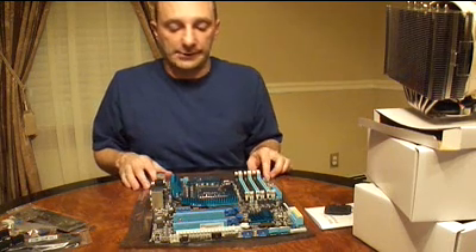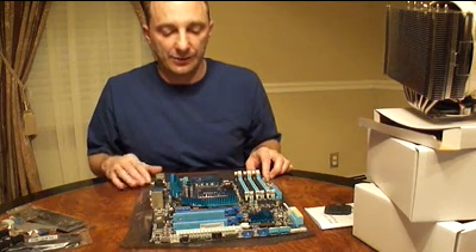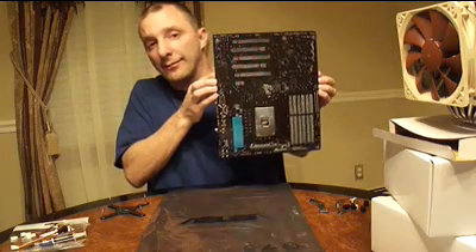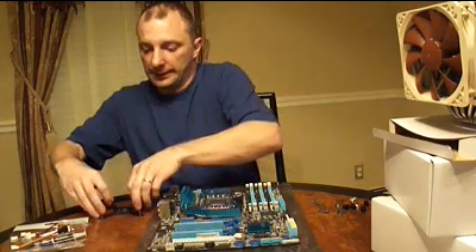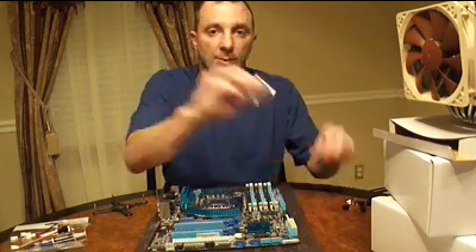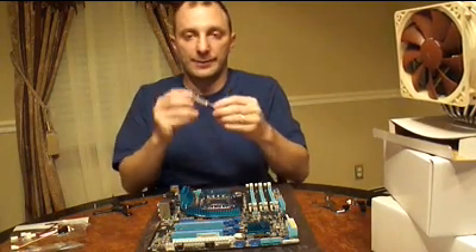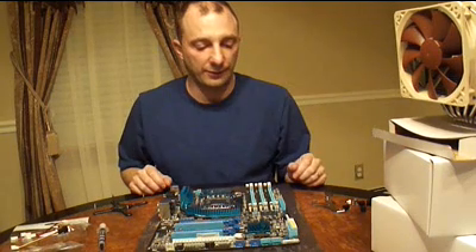So that's the first piece — now we're going to move on to the cooling system. The back of the motherboard is the reason why we haven't put this in the case yet: I need to put a bracket on the back of it. The bracket kind of looks like this, and that goes on the back of the motherboard. Then I'll put some spacers and brackets, and then the cooler on top of the CPU. There is a little thermal compound that's necessary — a very small dot of it I'll put on there, drop the cooler on, and then we'll be good to go. Then we'll see if it interferes with the RAM.